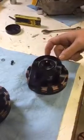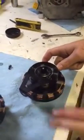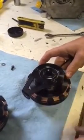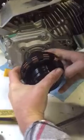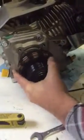This is only the first step — you also have to make sure that the assembly slides onto the shaft so that everything is perfectly aligned. Take the assembly, pick it up, put it on the shaft, and then disengage the clutch so that it slides on.